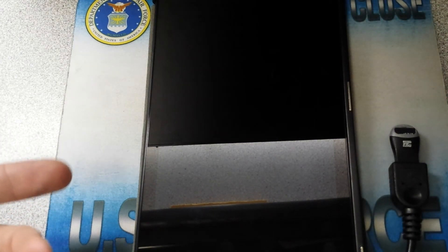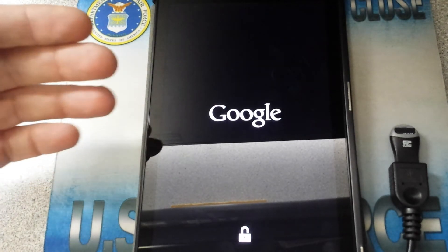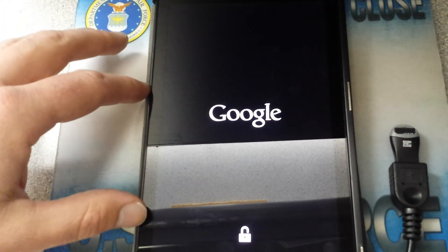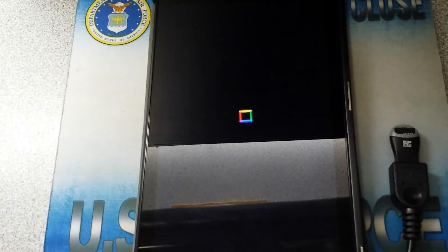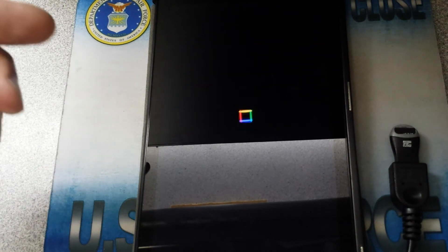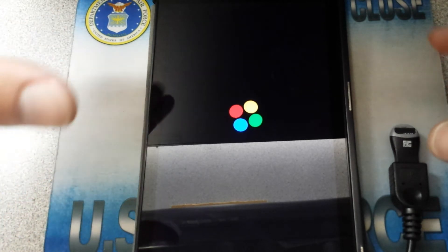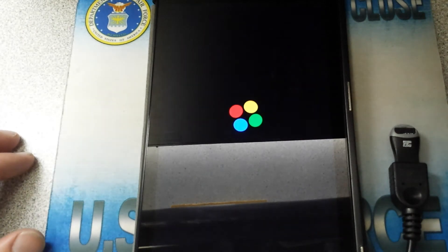So to recap, I showed you how to make an Android backup — it's very simple. Check all the little boxes on everything, and then take it. Once it's saved, leave a copy on your internal, then stick another copy on your external, and on top of that put another copy on your computer. I do it about once a month or so, though some people do it a lot more than that. Remember, when you put it on your SD card externally, you've got to create the folders identical to the way Team Win Recovery Project creates them on your internal when you hit Backup.